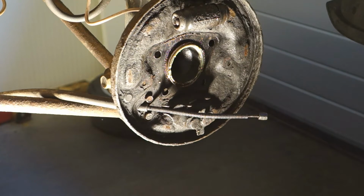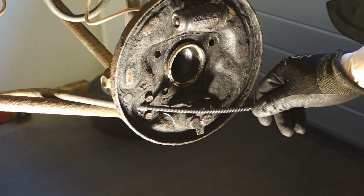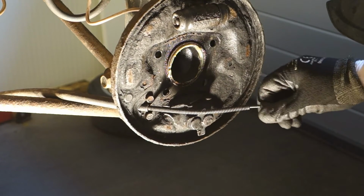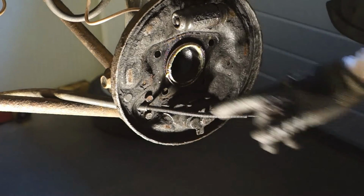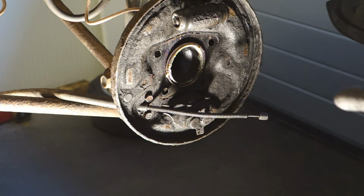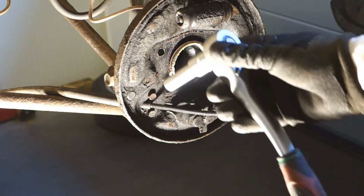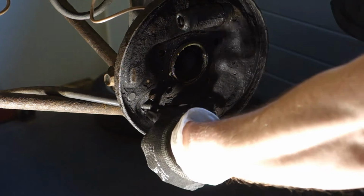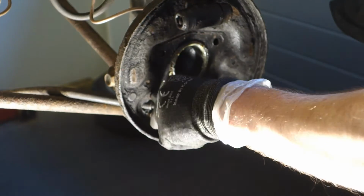Okay, and now when those brake pads are away, I can do this brake cable lubrication test, that 2 fingers and then this movement. And now we can see that this is so stuck that this part doesn't move at all. And that means that now I need to take this cable away, and there are 2 10mm bolts which I open. Next there is a 10mm socket, and there is one, and when I have opened these two bolts in here, then it's easy to take this cable